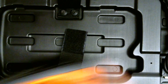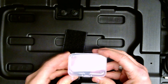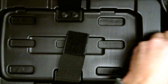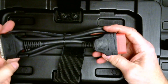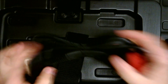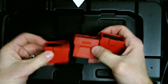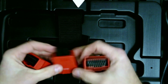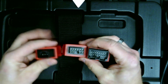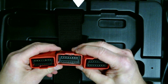Let me show you some of the other things inside the case. There's a plastic container labeled for super transponders, to hold your super chips. There's an OBD2 cable — looks like DB25 to OBD. There are a couple of OBD adapters labeled for Honda and Kia — these are your remote programming adapters for Kia, used when programming under the hood by connecting to the fuse box.